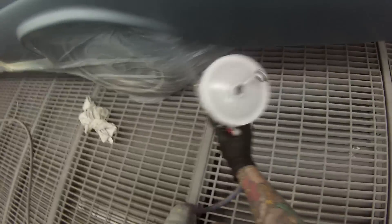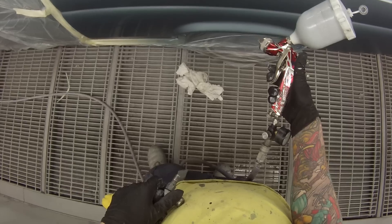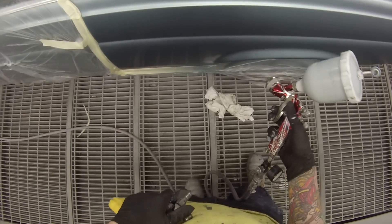I'm skipping that section mainly just to stop the video getting too long - it already got up to around the 20 minute mark anyway. I use the GTI Pro again just for that blending clear, because I like to blend into it when it's still wet. If you're a water-based painter, that's otherwise known as a wet bed. In Standox, which is what I'm using here, that was just straight 599 mixed at a 1-to-1 ratio - 50% thinners, 50% of the 599 - and then use that to blend.